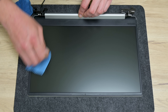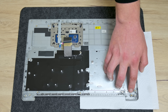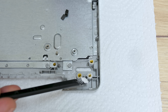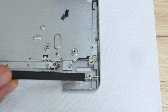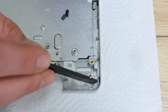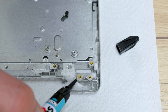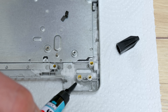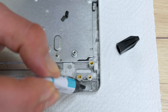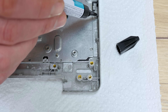Or if I need to change the display. The display and the whole top case are almost like new. Now I return to the palm rest — the glue is dry, but I had to reinforce the case somehow. To reinforce the case, I used a very simple method using baking soda. Carefully I put baking soda around the broken part, and over the baking soda I add superglue. The baking soda and superglue have a small chemical reaction, creating a little bit stronger bond. After applying the glue, I left the case for about 24 hours to completely dry.